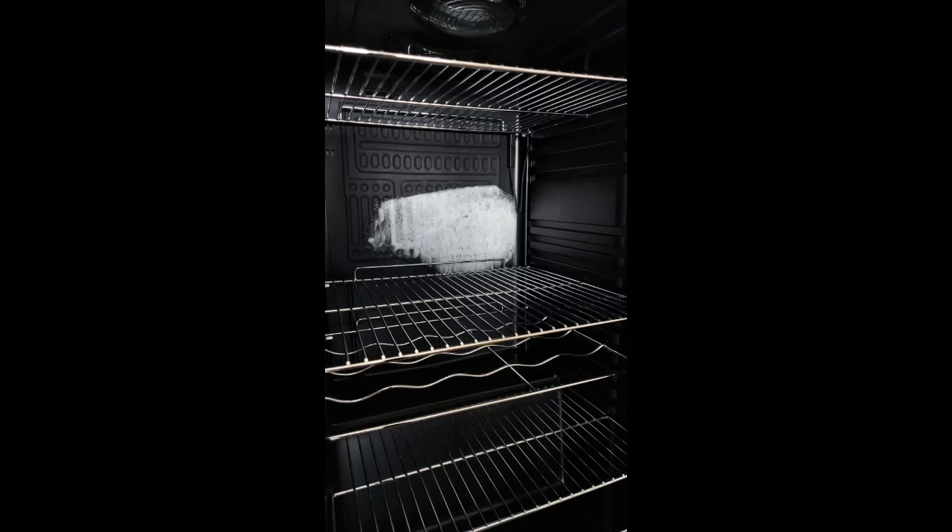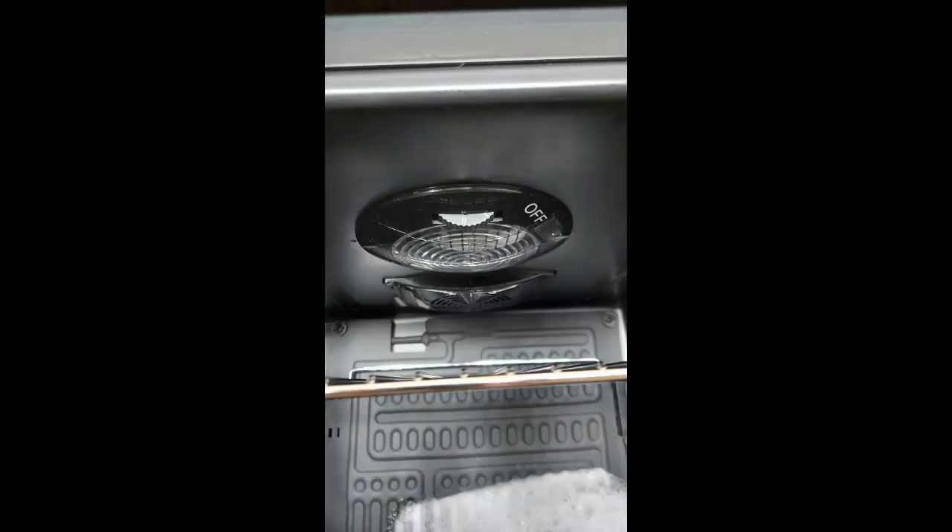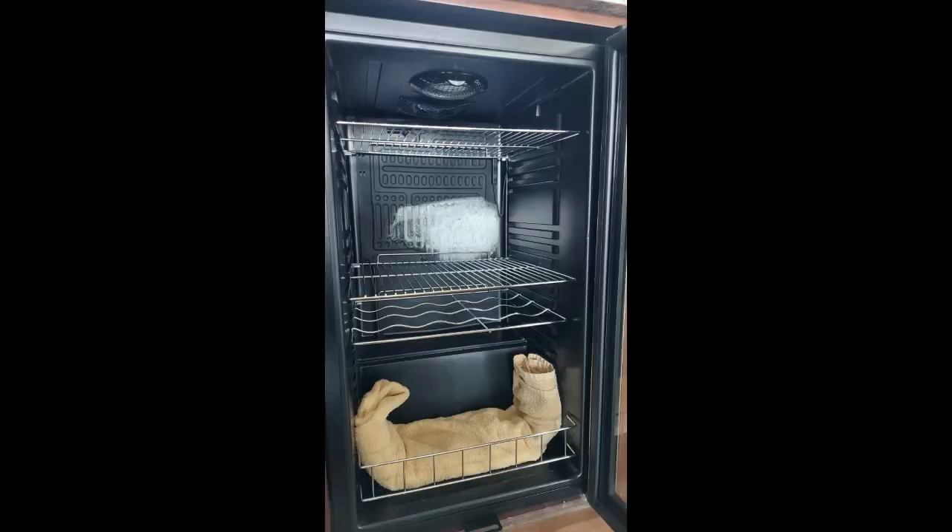A list in the description below may help you decide whether to consult the manufacturer or try this method. To rid your machine of the frosty ice buildup, begin by emptying the contents, then turning it off and unplugging it. Place a towel at the bottom in order to catch water from melting ice.